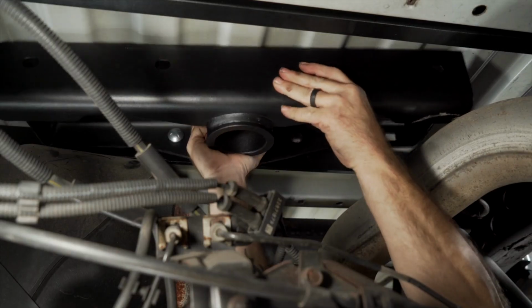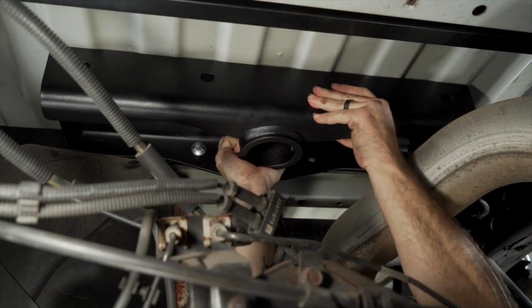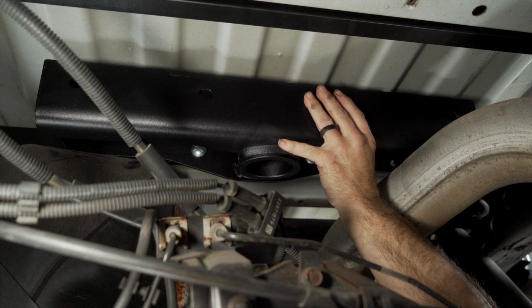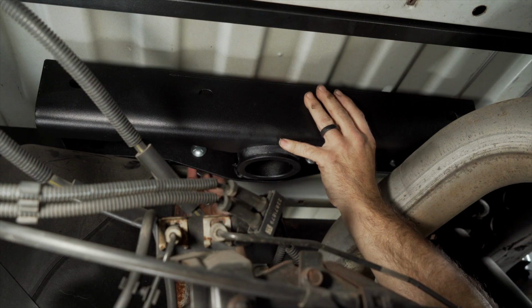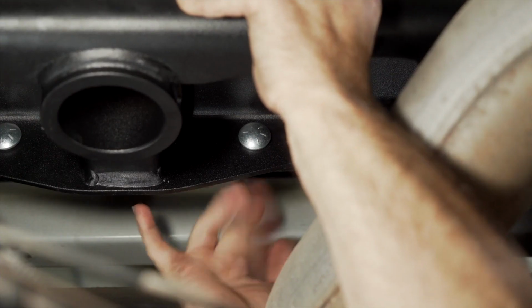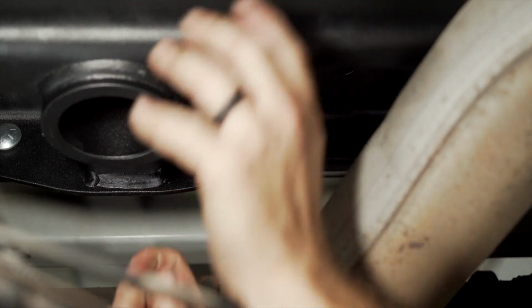You can now raise your center section into place with the hole of the gooseneck offset to the rear of the vehicle, so the previously placed bolts will face forward through the forward cross arm. Once placed, thread both flange nuts to hand tight so it will hold the hitch so you can proceed forward.